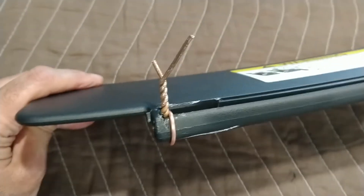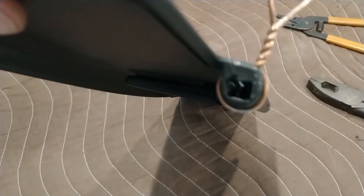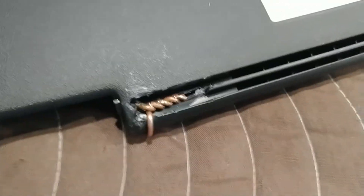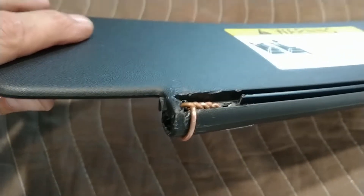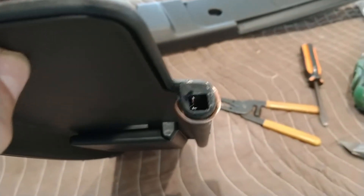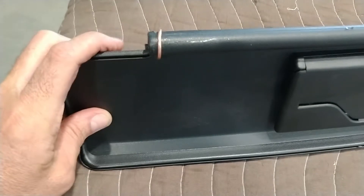Go ahead and twist it now and you can see what it looks like twisted. Here's the component twisted — now you're going to try to lay it into that channel, but you can trim off the excess before you do that. You can see already that the portion that's been cracked is already tightened up. That'll hold that pinion a little bit easier. Here it is laying in there — I trimmed the ears off, slowly pushed it in. You can take a flat blade screwdriver, tap it in, and try to get it laying down as best you can. You can also take some channel locks and go around this ring to make sure there are no flat spots on it. You want to make sure the wire is as close to this end as possible — you don't want it in too far. That should work.